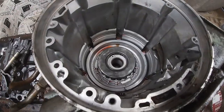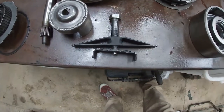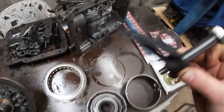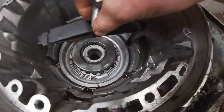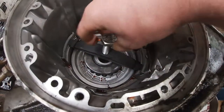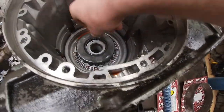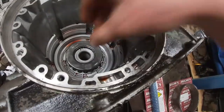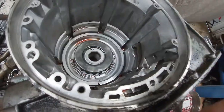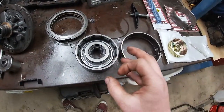And then you have to do the same thing in here. So that's what this special tool is all about. So we've got that guy, which goes on the end there, that pushes on the retainer. And then this part of it, I've shaped it just right, so it goes down in the grooves and then turns into the circlip groove like that. And then you just tighten it up and it pushes down. And same thing, you got to push down on the retainer, pop out the circlip, and then it exposes all the springs and you can get the piston out. And exactly the same thing as this assembly, I've just popped the circlip out to make sure the tools work,